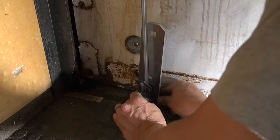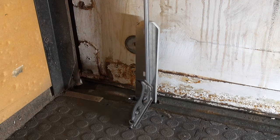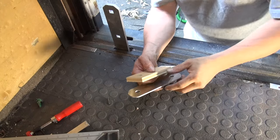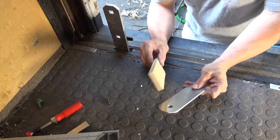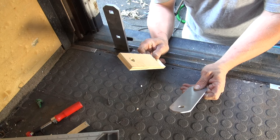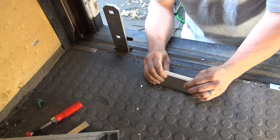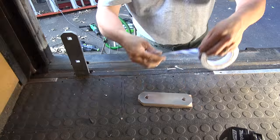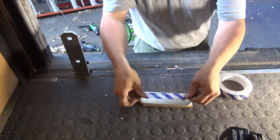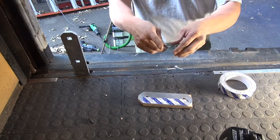From the inside of the truck again, I squared the bar stock coming through the floor and then measured the distance between the bar stock and the door. Now the 1/8 inch aluminum shim is supplied by FastCap which will be needed for most installations, but I needed an additional 1/2 inch to get it past the framing member on my truck body. I tend to use FastCap speed tape for everything and right here I'm using it to adhere the metal plate to the wood spacer.